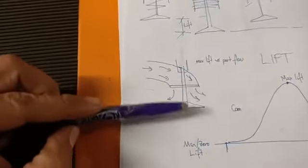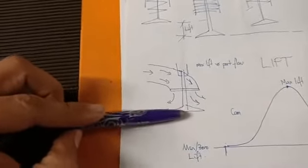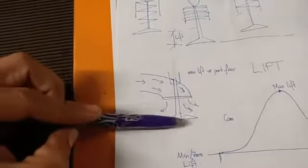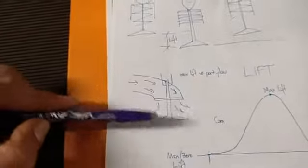With camshafts generally, the bigger the lift, the usually better the flow. There are some other considerations, just some basic ones without going into too much detail. Comes a point where, let's say we had heaps of lift, and imagine our valve was here, well, our port's now the limiting factor. It doesn't matter how much our valve's opened. So it comes a point where more lift doesn't really do much more for flow. But again, the more the merrier in most cases.